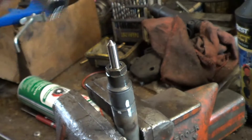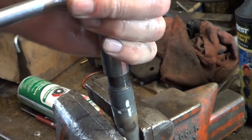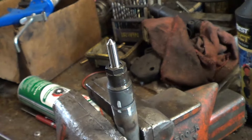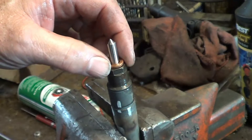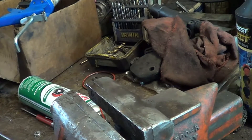You want to make sure the inside of your socket is clean — I just cleaned it out with the same process I did on the injector, so it should be just as clean. We put the compression washer on there — we could put a little grease on it, or we could just drop those in the holes in the head before we mount the injectors. And of course doing the number three injector is slightly different, so we'll show that one also.